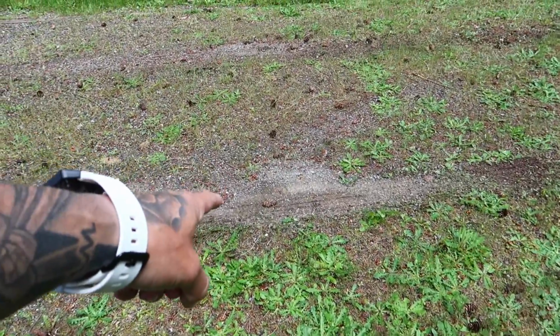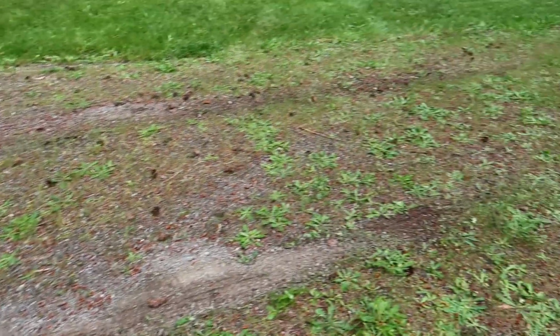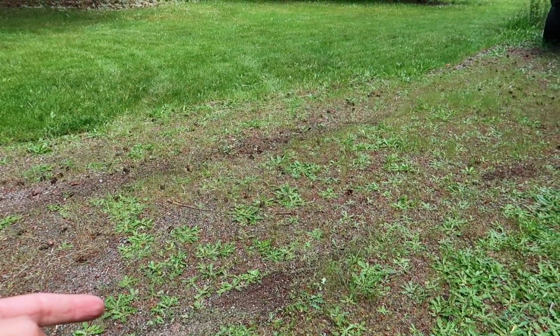So that is a win. That saves so much time, and then I can sell that rear diff. So it was just the pump. I changed the Haldex and the pump, and it was just the pump. So you guys can see, and Jeremy, you can see, this is where I did the test before, and it just dug in. It didn't launch at all. It just dug in the front tires. This is where it did this time, you can see the four tires, and it didn't dig in, it just launched.